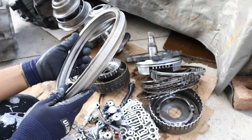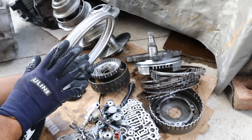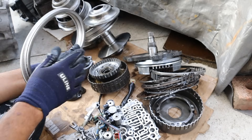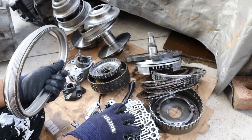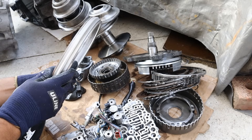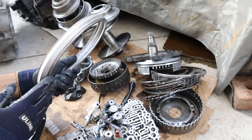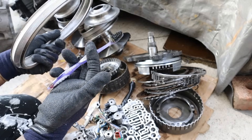That's pretty much a look inside of a failed Nissan CVT. There are a lot of failure mechanisms inside of here, and a lot of it has to do with the fluid — you've got to make sure you change your fluid if you don't want this to happen to you, and make sure it's cooled properly and you don't abuse the vehicle. Failure mechanisms include the variators themselves failing, the belt snapping, the clutches failing, the valve body getting clogged up, or any other moving part — just like any other automatic transmission. It's unfortunate that Nissan had to go through a huge lawsuit to address the problem, even though their late model cars are still failing. Make sure you subscribe if you want to see more videos like this one.